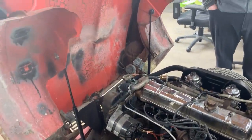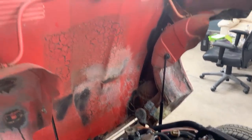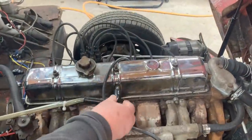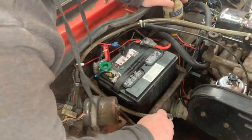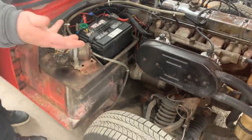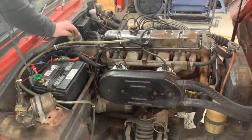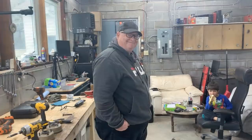The good thing is whoever repaired this car didn't know how to weld, so all the repairs are done with fiberglass and we just have to peel it. I like this modification though - this is like the best Triumph modification I've ever seen. This little fitting off the valve cover goes into a tube so you get any oil vapor, and that actually goes through into the frame so it oils the frame internally - so you don't get any rust! Fantastic - a self-feeding oiler. I might retrofit my cars.